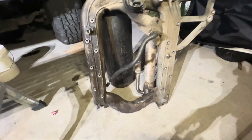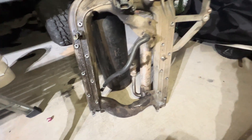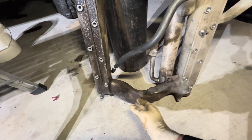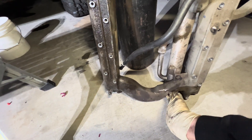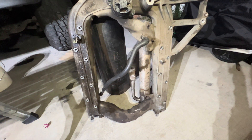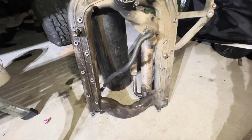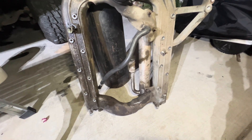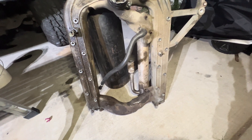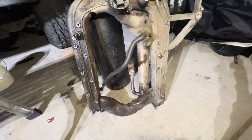I got the intake manifold off. The thing I hate about the '03s is this horseshoe right here. We're actually going to cut it right here and right here and then weld a plate there. So if this issue ever happens again — say the high-pressure oil pump goes bad, which it shouldn't realistically — the pumps usually last, and we're going to be using a Bosch pump.